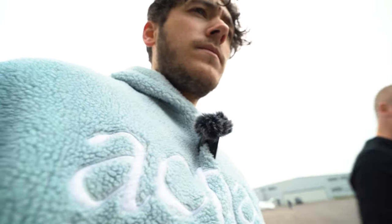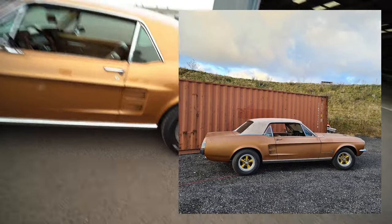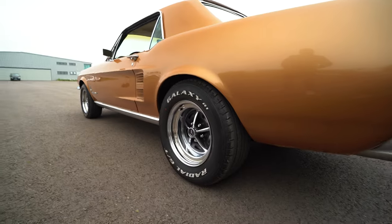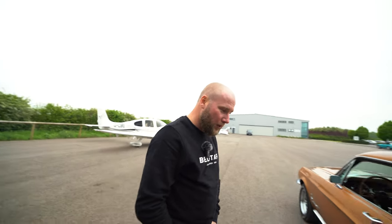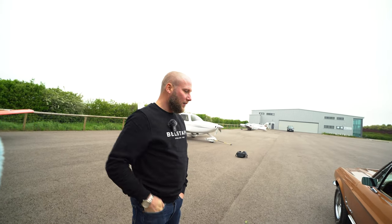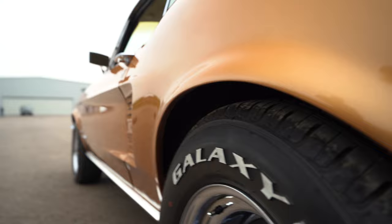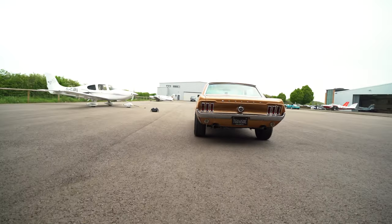I love it. For anyone going to be doing up Mustangs and restoring them, wheels are a game changer. You need to get the right wheels. These are not original to the car. I went through so many different stages, tyre sizes, backspacing. It would have come with Torq Thrust on. But Magnum 500s, in my eyes, fill the arch perfectly. Sometimes they sit too high, and that's the worst, when you've got that big gap. From the back, you see the stance. The wheels are a lot wider than the front, and it suits it, because you want the thicker tyres at the back anyway.